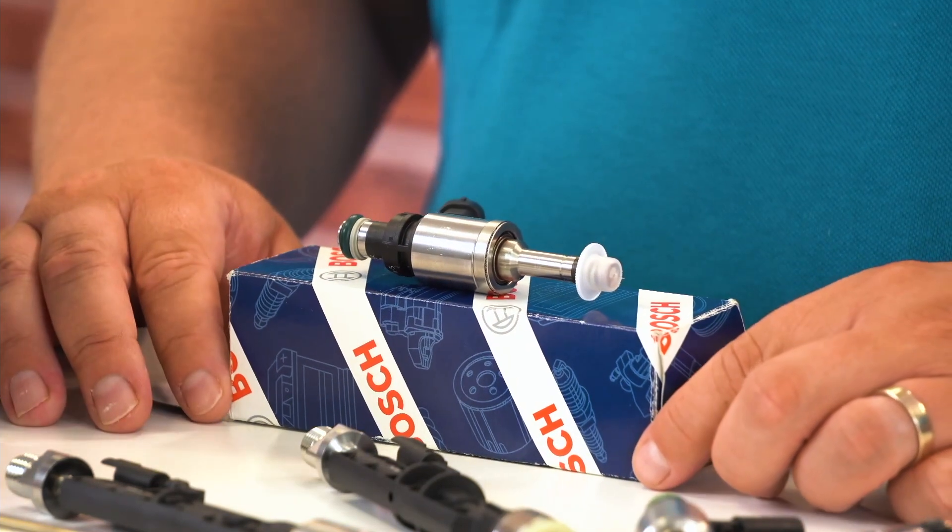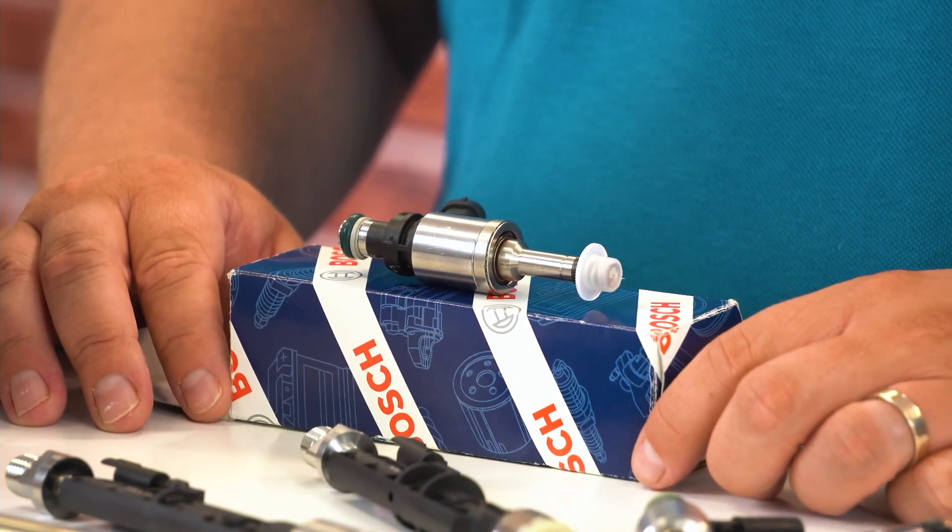How to install and disassemble high-pressure injectors. Often you can pull them out by hand because they do not get stuck as strongly as injectors do in diesel engines. Defective high-pressure injectors should be replaced with new ones. New injectors come ready to install out of the box. If not all of them are to be replaced, the old ones need to be fitted with new Teflon C-rings, O-rings and remaining parts from the spare part kit. Failing to do so increases the chance of leakage, which occurs mainly not immediately but after a certain operation period.